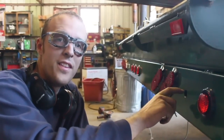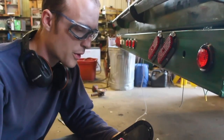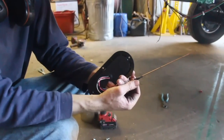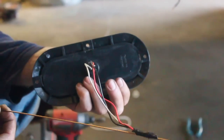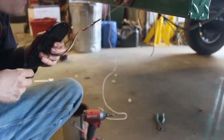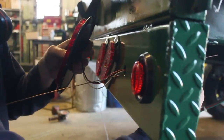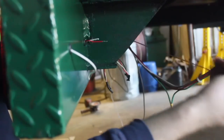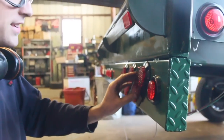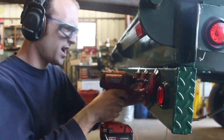We've got a three-quarter-inch hole on one side of the light bar where the light body runs through, and a quarter-inch hole on the other side through a grommet — about a half-inch outside the grommet — where all the wires run through. A trick I figured out recently: take a piece of filler rod, tape your wires to it — making sure the tape extends past the wire ends to act like a funnel — then poke it through the hole and pull the wires with it. Now our wires are run through in very little time. Then hold the light up and secure it with a sheet metal screw.